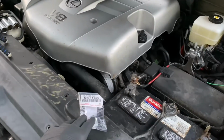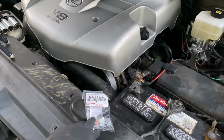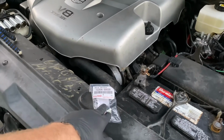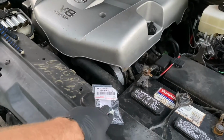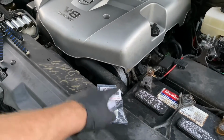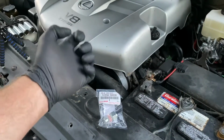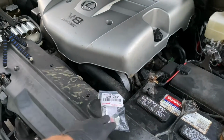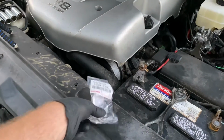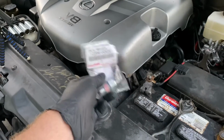So the PCV valve is part of our emissions process, but it's good for our car to have this maintained because it keeps our oil clean. It keeps the oil from getting contaminated with products that blow by. If it gets clogged and stops working, those vapors just build up in the crankcase and dissolve into the oil, and so it shortens our engine's lifespan and makes the oil not as good. And because this is venting those vapors, in time it gets junked up and stops working.